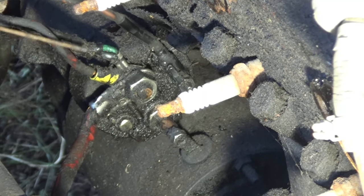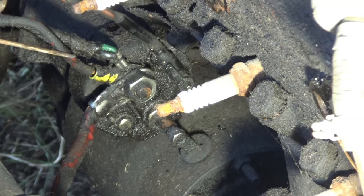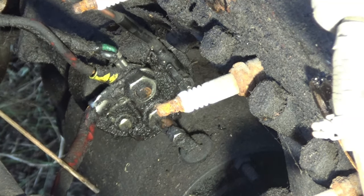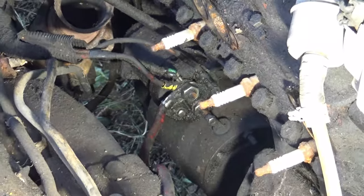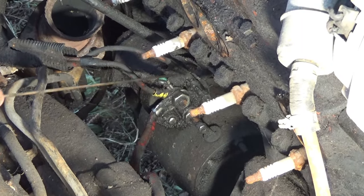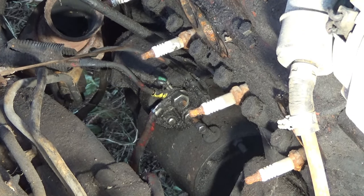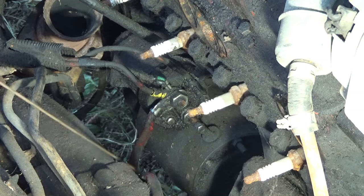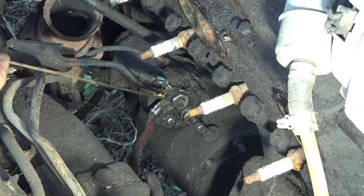You have the wiring harness from the truck right here. This powers all your accessories, including the ignition that goes to your distributor — it powers your lights, everything. This right here is just the main cable that goes to the battery. The most important part is the wire that connects to the little terminal that says S on it. That needs to have 12 volts whenever you turn the switch all the way to start. This big one obviously needs to be hooked to a fresh battery — it should have 12 volts constantly.